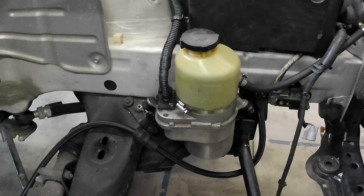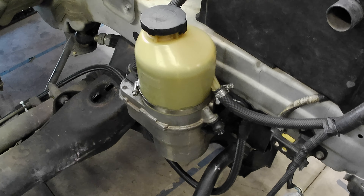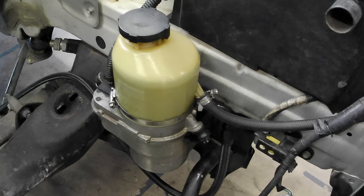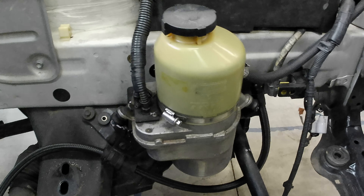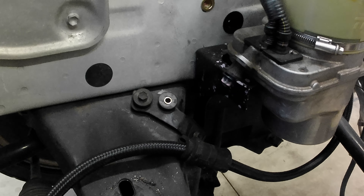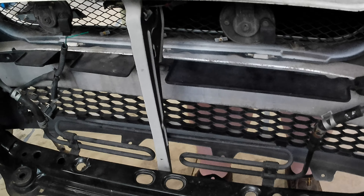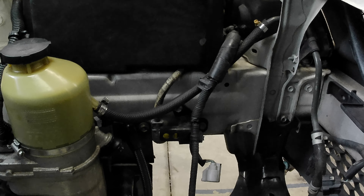First is the pump. This is a TS or AH Astra and these are going on eBay in Australia for about $200. There are other pumps you can use but this is the most common and I feel it provides the best steering feel. No matter which pump you use they all work basically the same — they have a high pressure side that feeds the rack and a low pressure side that the fluid returns to. The only difference would be the wiring. You want to install the pump somewhere that you can easily run the high pressure and the return to. The pump is on an alloy bracket, link in the description below, and is fixed to the chassis using rivnuts. On this car the return comes from the rack down the chassis rail to a cooler in front of the radiator, and then I've used trans cooler line to take it up from the hard line to the pump.